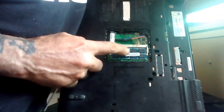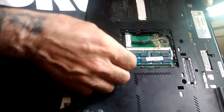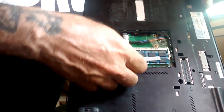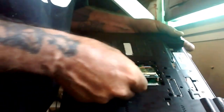Now here we are. There's one of our memory sticks right here. It's a little dirty in there. Make sure you don't have any static. We're going to pop up the little clip right here and slide it up. Pop it up. Once you get the clips out, the little memory stick pops up — you've got to pull it out. Set it down.